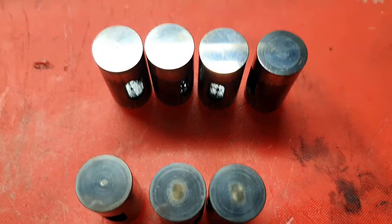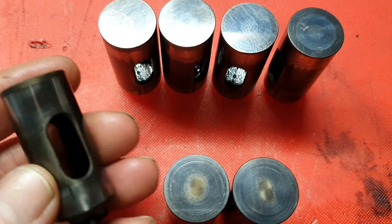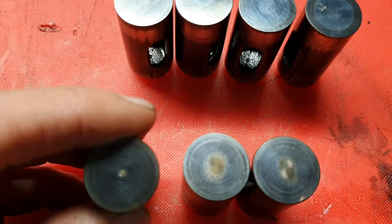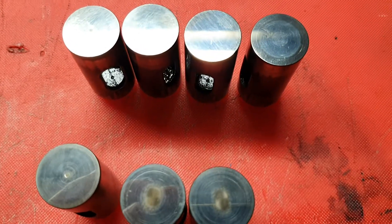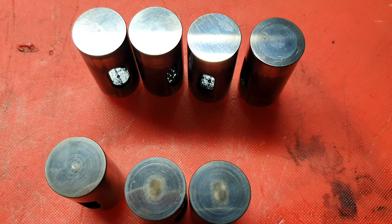They're chill cast - they use virtually white hot molten metal poured into a chilled former, pressed, and that makes them very dense and very hard. They're then finished off in a machine shop, properly hardened, then polished and finished, and they come ready to go on the bike.